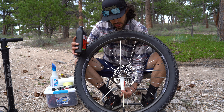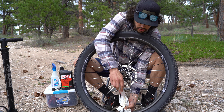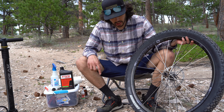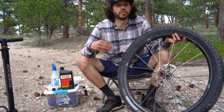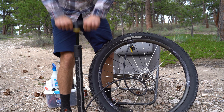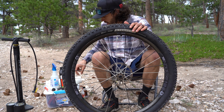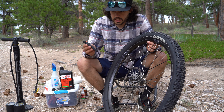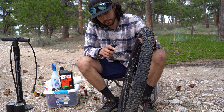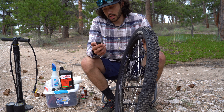One and two — and then with your rag you can unscrew it. That's going to be much cleaner than adding sealant beforehand. Obviously it's an extra cost with the syringe and the valve core remover, but I think it's well worth it. So we'll add the valve core back in and pump up the tire. I set it at 21 pounds on the pump. I really like to use one of these electronic pump checkers because they're really accurate — double-checking confirms about 20 PSI, which is a good baseline.